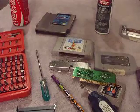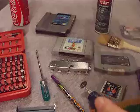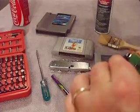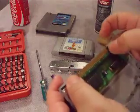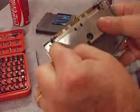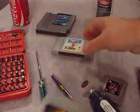Get a brush and give it a little brushing. First things first, put that plastic piece back on. Put the ROM back in its place — it flip-flops around and wants to fight. That little plastic piece has to go in so it doesn't slide back and forth, and make sure the screw holes align. Then take the shield and inspect it — sometimes I've seen rust inside the shield itself. Put your two screws back in. Then go ahead and put your cartridge back together: it's like making a sandwich. Slide it in the front, then slide it closed, put your two screws in, and you're done.